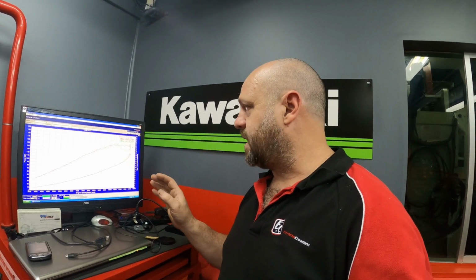So that's going to be it for this video, and it's given us our good baseline. We started with 161 with the OEM muffler, and then we've gone up to 168 horsepower with the slip-on SP Engineering muffler, and then by removing the air filter I've gone up to 171 horsepower. Now that tells me that there is power to be had in a more free-flowing air filter. Next video we are going to start looking into the engine. We've got some engine upgrades and we should see that power go up substantially.